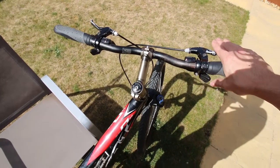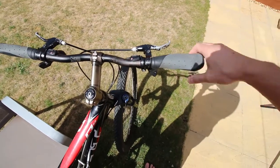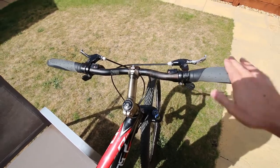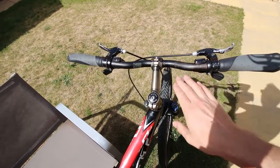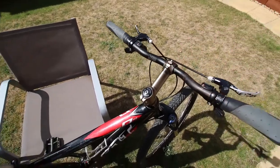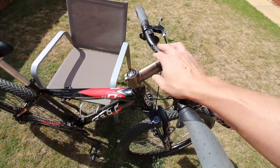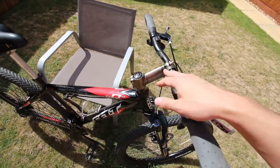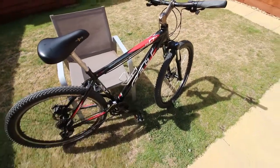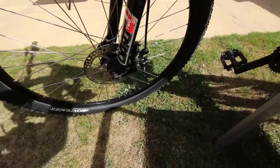The brake levers need replacing, the grips aren't that great either — they're a bit of an odd wedge shape and a bit grimy from when the previous owners had them, so I'll replace the grips. I'm going to replace the handlebar because it's rusty and it's been slipping around in the stem. I'm thinking maybe some oil or something has gone here, and I'm not sure if I need a new stem but if I do I'll have to order one. I'm also going to service the disc brakes — it's got Hayes cable disc brakes. They work and they stop the bike but they're not that effective.